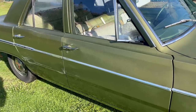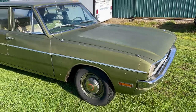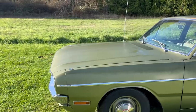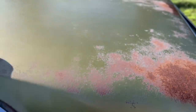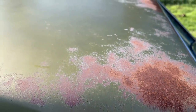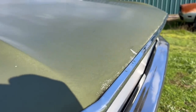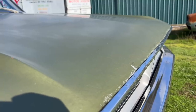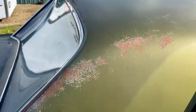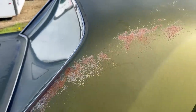Here's an interesting look at old school touch-up paint. When it went on the car, that fog line would have been blended much better, but the paint they put on after the fact fades worse than the factory paint, so you end up with this look eventually. You can actually see right where that touch-up repaint ended. Factory Chrysler paint, as it wears off, reveals red primer underneath, but also kind of a gray stuff. It sticks to the paint really well and comes off with it. When you see bright gray primer staying behind as the paint peels off slowly, that is not original — that's definitely an area that's been repainted. My Demon actually has a large area like that too. I'm no expert, and different cars, different years, different plants are probably different, but this is what you're going to see when original paint is slowly removing itself from a car.